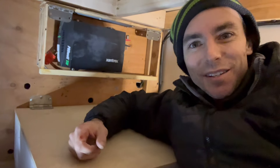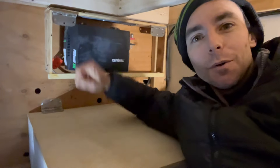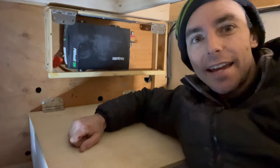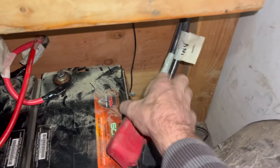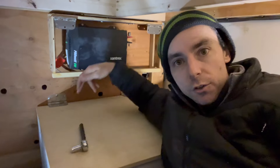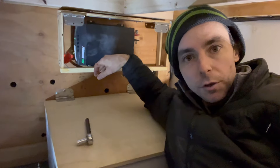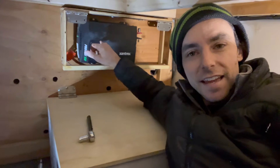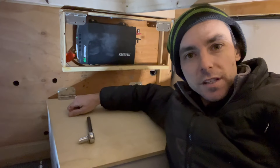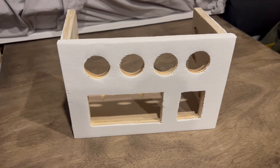Time to finish up this electrical work. The batteries have been running great, now we want some AC power - gotta wire this inverter up. These are the biggest cables in the van. The fuse holder broke, got a new one. Create the cable from the positive to the fuse holder, from there to the positive of the inverter, then the negative from the shunt, and another cable connecting this to ground on the bus bar up front - then we'll have AC power again.